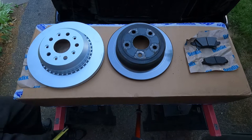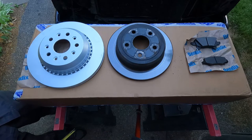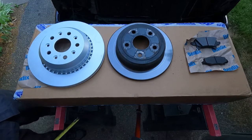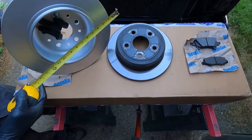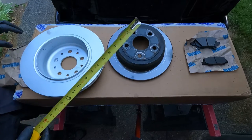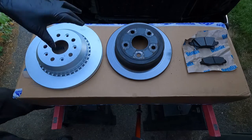Like we did before, we'll measure the diameters. The rotor hats are the same dimensions as far as height and depth. When I bring it back to the Jeep, I'll show you that it uses an inner brake shoe for the emergency brake — it's not the spring-loaded brake caliper where you have to twist in the piston to compress it, which is really awesome. The JT brake rotors are thirteen and three-quarters inches in diameter.